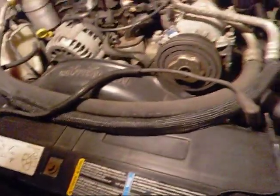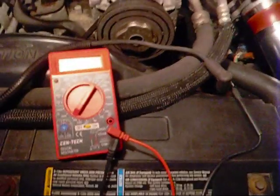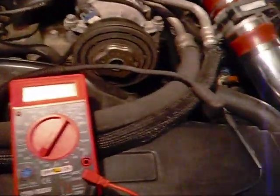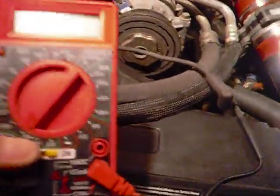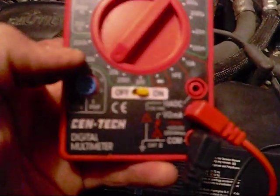That's a quick easy way to check if your spark plug wires are good. My pops actually told me the old school way was to start it up and let it run with all the lights off so it's dark out, and see if there's any sparks coming off the wires. I did that a little while after I changed spark plugs and didn't see any sparks, so I figured they were all right. But you have to put the multimeter on ohms — it's like a weird horseshoe-type symbol — and you don't want to put it on 20k.